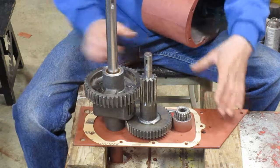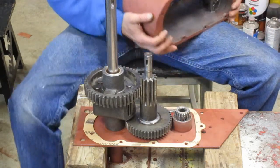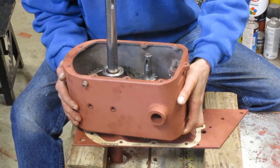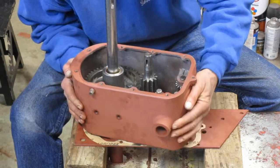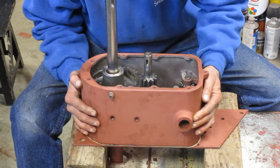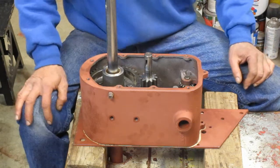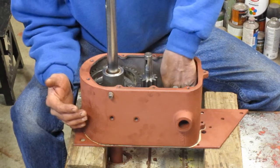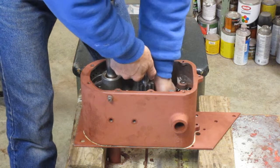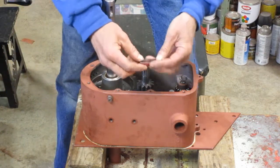Put your spacer in place to hold the gear up. This should be oriented on a slight angle so it's in line with this shaft. First go over the ring gear with the flanges. Next you go between the bosses. You have to go down far enough to move forward over the input shaft, then you can rotate into place — straight down on the gasket. I would recommend practicing that. Do it without sealer first. Make sure you've got your spacer in the right place; if it sticks out too far the case won't go past that. When you're done you've got to get in there and get your spacer out, then drop your gear back in position. Make sure you clean this thing before you do all that.